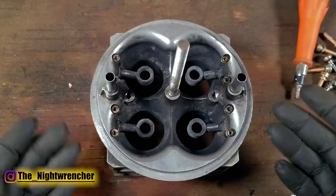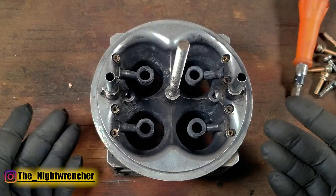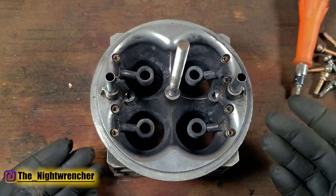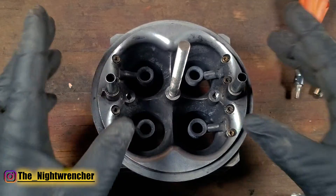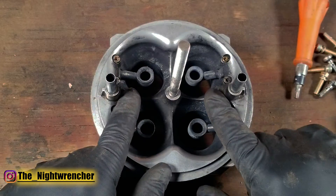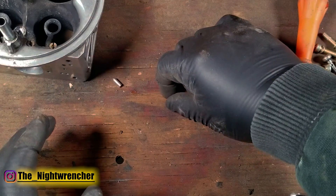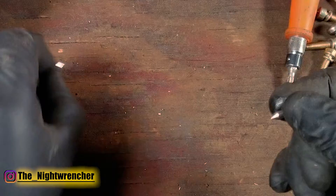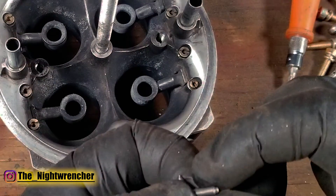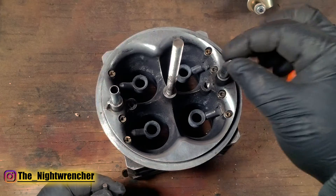You'll have one or two accelerator pump nozzles depending on whether you have a mechanical secondary or vacuum secondary carburetor. Vacuum secondaries have only one nozzle; mechanical secondaries have two. This is a mechanical secondary carburetor, so it has two nozzles. Underneath the two nozzles there are two needles — carefully flip it over and they fall right out. In this carburetor the needles are stainless steel. They sit inside the main body and act as a small regulator. Make sure these needles go back in to keep the whole system primed and charged.